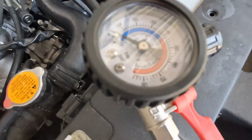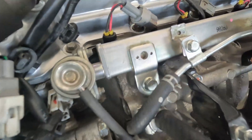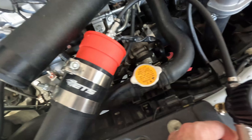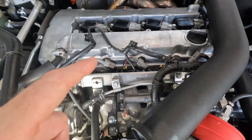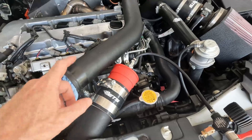Everything seems to be working with the tester, but I do seem to have a problem with the car. Listen for the hissing sound. It really sounds like it's coming from where one of the injectors goes in, and if I move it around it seems to change the sound of the hiss. I'm hoping it's just an O-ring down there where it seals. There's hardly any pressure built up and it's already leaking, so I don't want to push it. One good thing is I already have new injectors to replace these, and they'll come with new O-rings. The 1050s won't be enough for the power I want to make anyway, so I'll redo the boost leak test once I get the new injectors in.